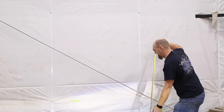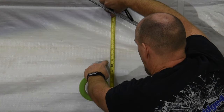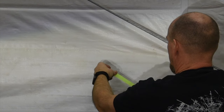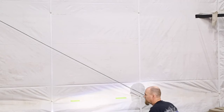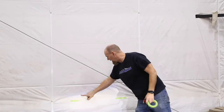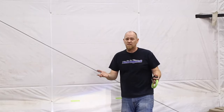Then we'll move over a little bit and do the same thing for the other headlight. Now we'll turn out the lights — you can actually see the headlight here and it's a little high for our headlight height, which is maybe why I've been getting flashed the last couple mornings on the way to work.